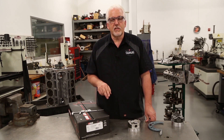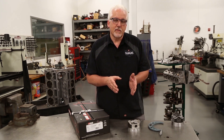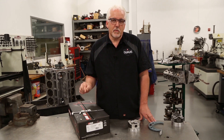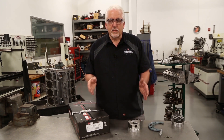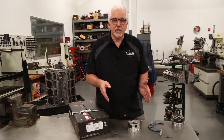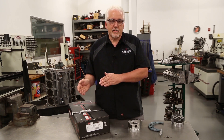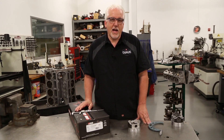The difference between the two numbers is 3 thousandths of an inch. Remember our minimum clearance is 2 and a half thousandths. So if we finish this motor at 4 inches, 181, we will be a half a thousandths larger than our minimum clearance. That's where you want to be when you put this motor together. Now for some reason, if you decide you want it a little tighter, you could actually go just slightly smaller on the bore size, but remember 2 and a half thousandths is our minimum clearance. If you want slightly more clearance, you could add a half a thousandths and make it just slightly larger — that would be your maximum clearance.